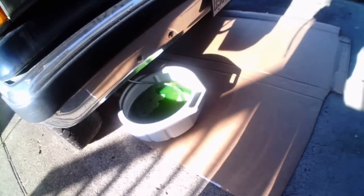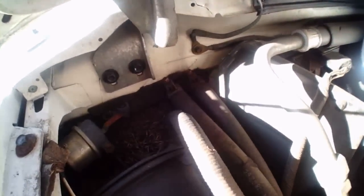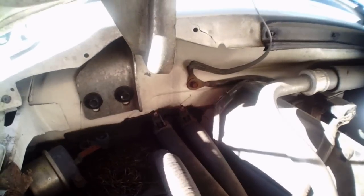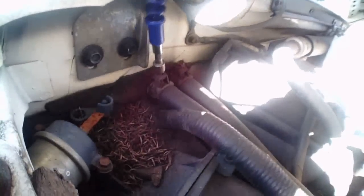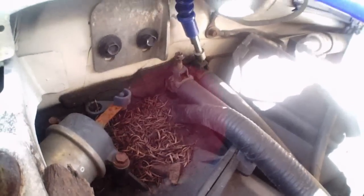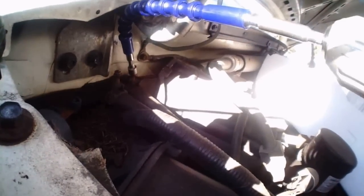Okay, now that we've drained out enough coolant, we can come up to the hoses here at the firewall, and they're 5/16 head or flathead screwdriver, and because of their position I'm going to use a little right angle adapter on my drill. Okay, so got to compress these straps to push them back into place. I don't know if I can do this with one hand.